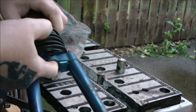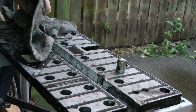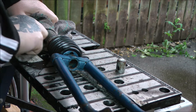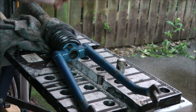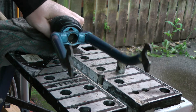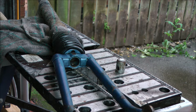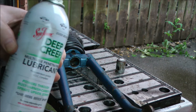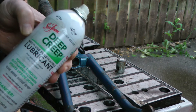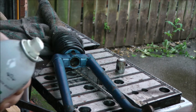Hopefully the rubber spring should fall out of here, but it's stuck inside — I can just see the tail end of the rubber. I think what I might do is pump the forks up and down a couple of times on the ground to see if I can get it at least part way out. I'm going to have to leave it again overnight with some penetrating fluid. I'm not sponsored, but Seafoam Deep Creep — despite the silly name — works very well and gets in between most rusted bolts. Worth a try.